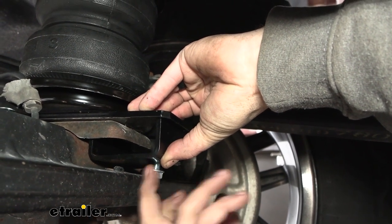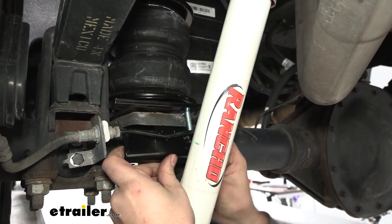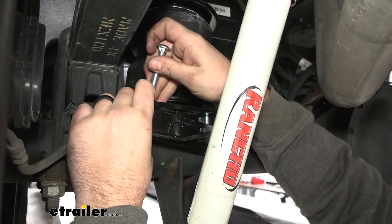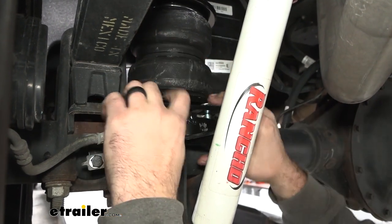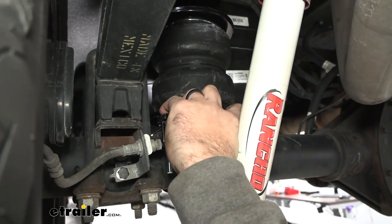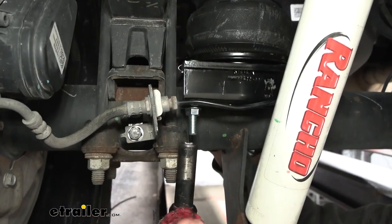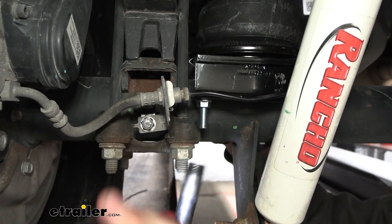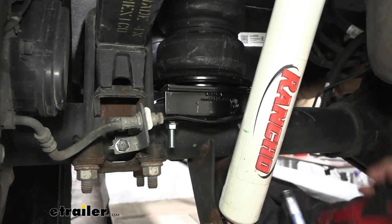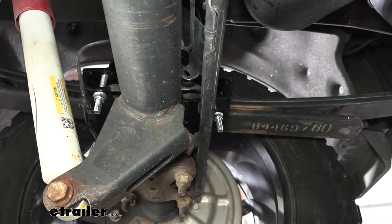If you're at this point you can squeeze the bag down a little bit to compress it and get it in place. Remember that plate we put in place on the back side — there's a slot in the lower bracket, so put that tab in there. Take your carriage bolt, pass it down, pinch these together making sure it sits in that slot, then take your serrated flange nut and hand tighten to hold that bracket. On the front side grab the other bracket from the kit and slide it in similarly. Pick the carriage bolt from the bottom plate, drop in the other carriage bolt on the other side, make sure it's centered up with both tabs in that lower bracket, and put your serrated flange nuts on hand tight.